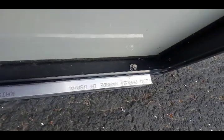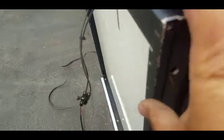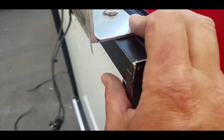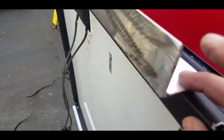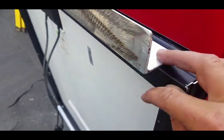Hardware is installed. Here's a look at the inside — the nylocks and flat washers give us about a three-quarter inch gap, an air gap all the way down the side for 46 inches on each side. That should be fine for ventilation. You don't want the panel flat against the roof — you want air circulation in the back to allow the panel to cool. Be sure to round your corners on the angle iron so a sharp corner doesn't poke a hole in your roof — that would be very bad.